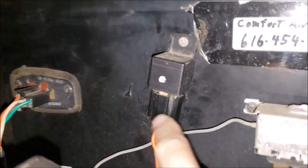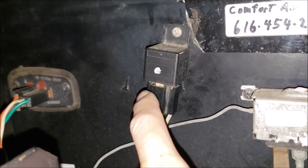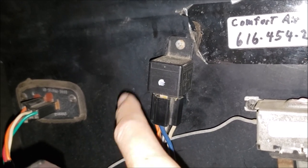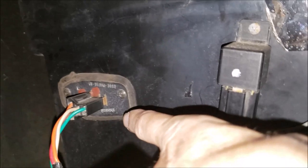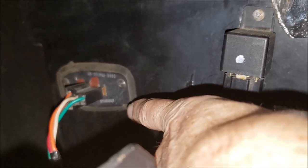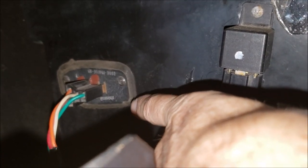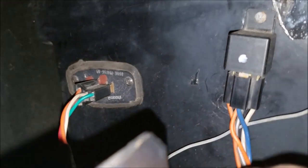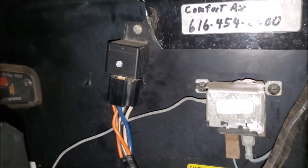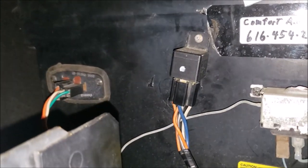Here's our relay out front. I believe it's this blue wire — it stays hot all the time and is just a pass-through that feeds the blower motor directly. And there's our little resistor pack — it gives us our different speeds. There are coils of wire on the inside, different lengths to create more resistance to make the blower run slower. So there you go — a couple of components to help you figure out what's what if you need to troubleshoot this thing.